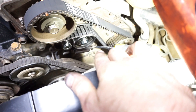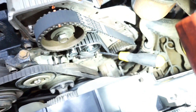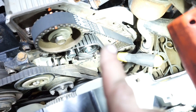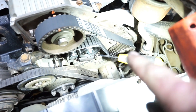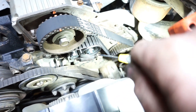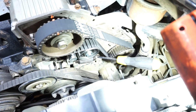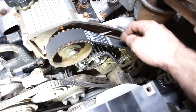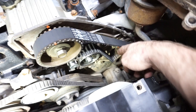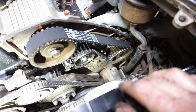If you're struggling to get this spring on, a little trick I use is a screwdriver. Put it in one end down here, pry it on the other side of that little pin that you want to hook it over. Once you get it over into the spot — so it's sitting on the other side of the pin — just hold the spring in place and pull the screwdriver out, and the spring will stay there. Now you've just got to feel the tension on both bits of the belt, and they should both be fairly well tensioned and not have too much play — then you know it's tensioned correctly.